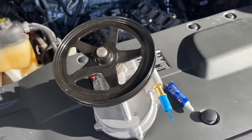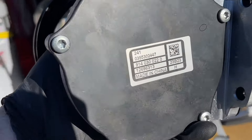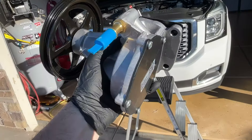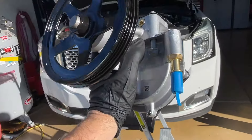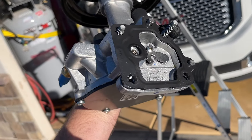If you want to attempt taking it off now, skip to about five minutes into the video and take the four bolts out and the vacuum line that you'll see at that point. If not, we're going to go a little farther right now just because I do have the footage for the exhaust manifold.